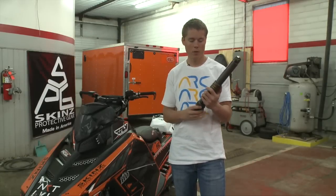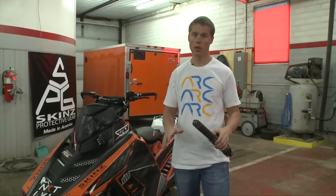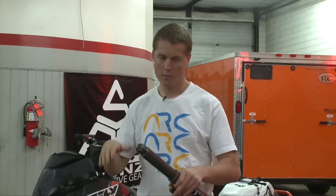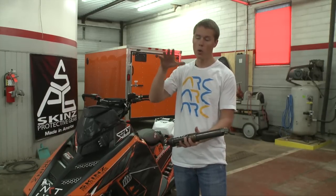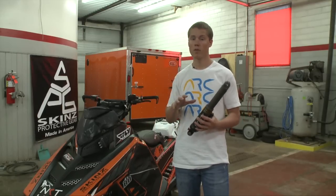One of the most important things that we're going to focus on when it comes to suspension tuning is spring rate. Spring rate and spring tension is either going to be a coilover spring or it's going to be the air pressure inside an air shock. It's responsible for holding the machine up — if you didn't have the spring rate, the shock would collapse and the front end would be all the way down. Spring rate is going to dictate how the sled is handled at the front end. Too low of spring rate means too low of ride height — it's going to dart, feel soft, and feel unpredictable. Too much spring rate and the suspension is not going to be active enough; it's going to feel uncompliant and rigid. If you're off trail doing technical riding and you side hill, you're loading that shock more, and if there's not enough spring rate, you'll over-collapse the shock. Spring rate is very critical. As a general rule of thumb, for technical terrain off-trail riding, you want more spring rate, more tension, and a very stiff front end.